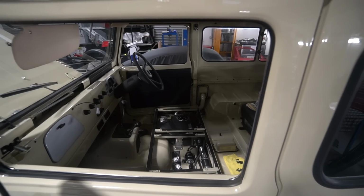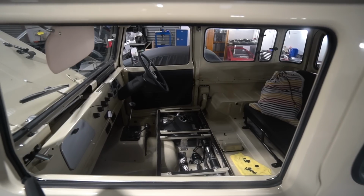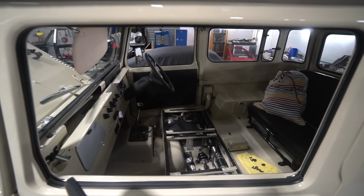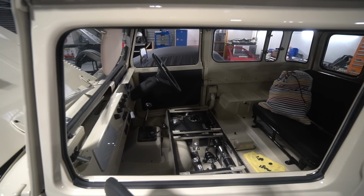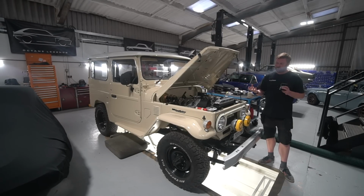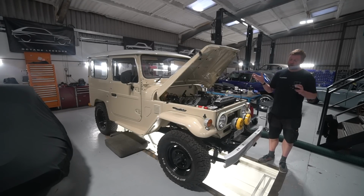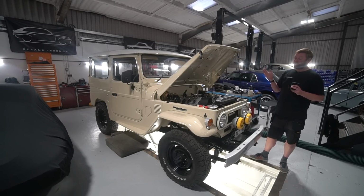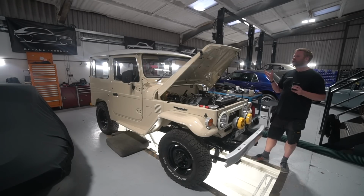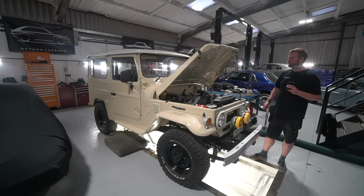So the only other thing on this at the moment is that we previously talked about the fuel filler hose, and we were getting fuel smell in the car from the Mocal fuel filler hose, which had gone very soft and was obviously smelling. So we swapped that out for some OEM fuel filler hose, I think it's Land Rover stuff, and we've got the same thing. It's not as obvious, the hose hasn't gone as soft, but we're definitely getting some permeation of odour through it.